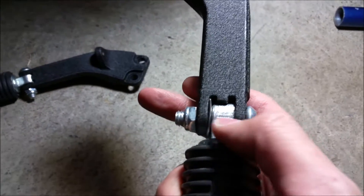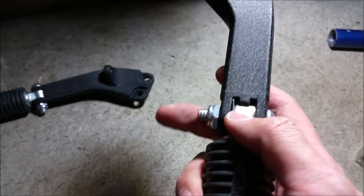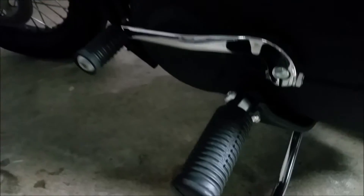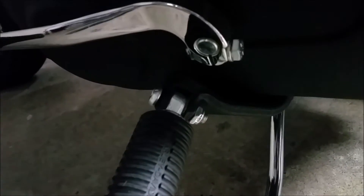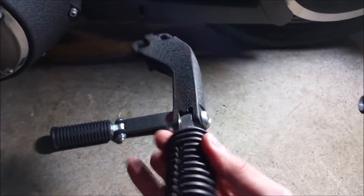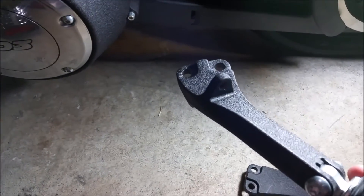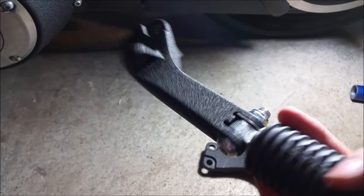It came with a shim — you can see this here — a metal shim that's bent a little bit, so it creates tension when you do this, so it stays up there. It took me a couple minutes to figure out the orientation of how they go. If you see your rider peg on the front, I basically copied that orientation. This hole here is where your belt guard will be mounted, so that's the orientation.